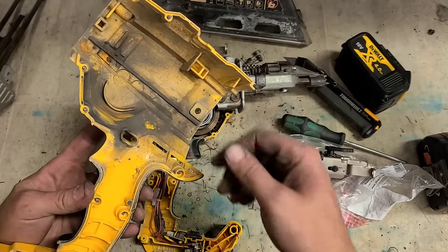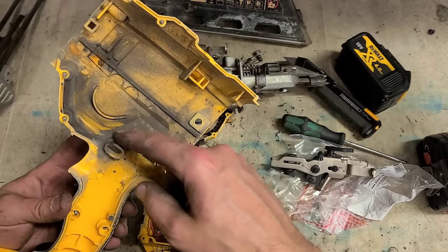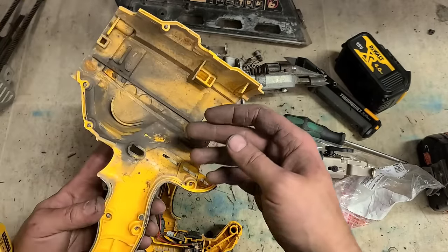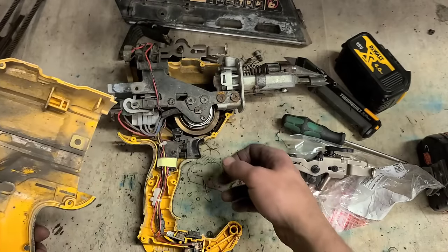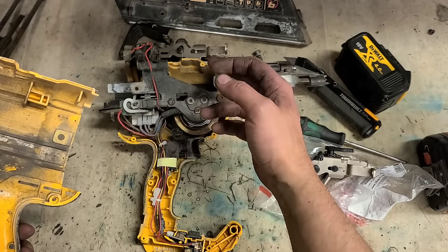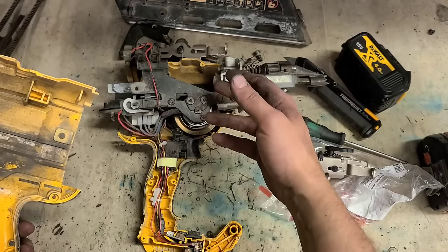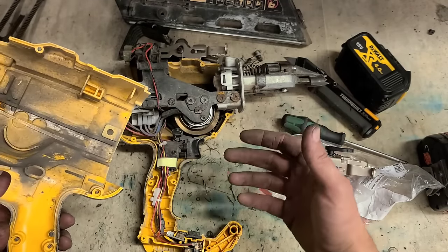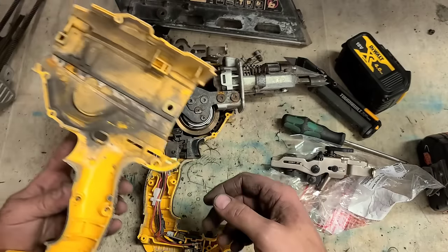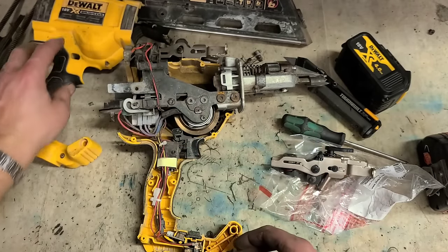But this one is fairly grubby on the inside. Generally a bit of dirt, it's not going to matter. But if there's carbon buildup or worn steel on top of it with carbon in it, that can create a lubricant that can interfere with your flywheel and driver unit. It'll make less friction so it won't drive as well. Any oil or grease is going to destroy it. So with that much stuff in it, it might just give us a wee clean out as well.